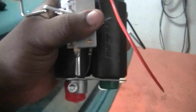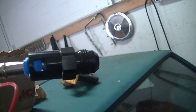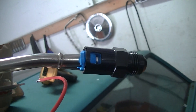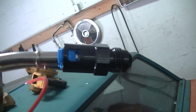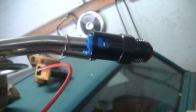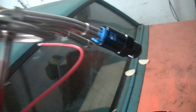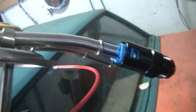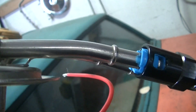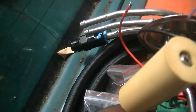Here's the end result — wires haven't been connected yet. I want to point out this quick fitting, which I believe is a 3/8 to 8AN for the feed. I'm not going to use this yet because I don't know what material it is. I'm hoping it's stainless steel and just powder coated. On the Monte Carlo, what we did was go to a store called Maker Hose where we get custom hoses — they welded a stainless steel bung, actually an aluminum bung, onto the end. I may end up doing the same thing, depending on whether this fitting can hold up to E85 corrosion.